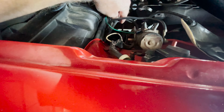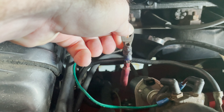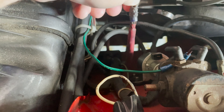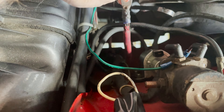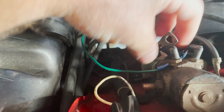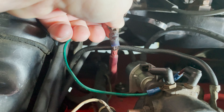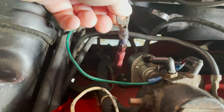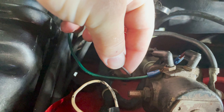This is what made me think to do the video, because usually I just get going and do the work without videoing it. When I looked at this yesterday, I could see, number one, this thing was piping hot, and you could see where it's starting to separate — where more than likely someone cut this and put an eyelet on it and did some sort of heat shrink on it. Anytime you start to see that, you could put some electrical tape on it if it wasn't too bad, but I just looked at this going, this is such a nice car. I'm not going to waste any time. I'm just going to take this off.